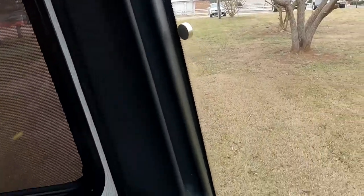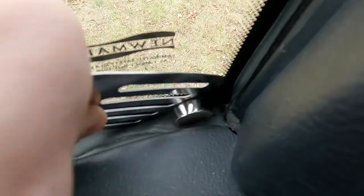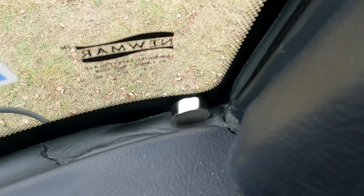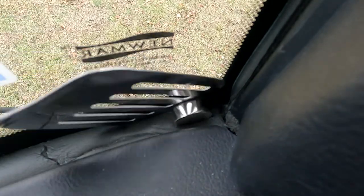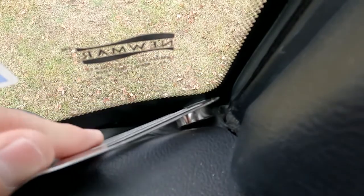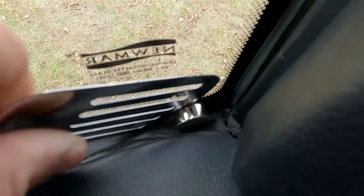As you can see, we have magnets located along the top horizontal, in the corners, and down the sides. Beginning with the bottom corner magnet, I take the metal spatula and place it against the adhesive which is between the magnet and the glass, and I rock it from side to side. This is much better than a back and forth motion and is much more effective. It takes a little bit of muscle and effort, but eventually the magnet does come free from the glass.